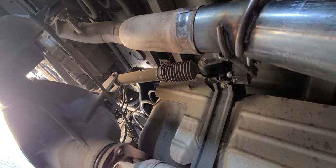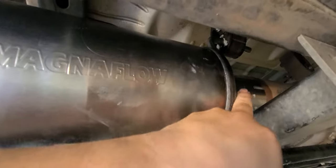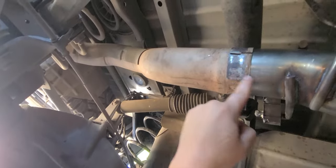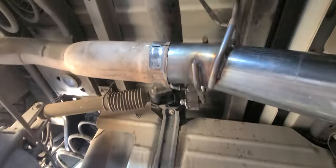Let's finish putting this together. This is fun because one of these goes in this way and one goes in that way, so I had to put these in first and then pull like crazy. I had to slide this all the way down to be able to get the front piece to slide in right here. Get your lube out and go to town on those rubber bushings because they'll fight you otherwise. We got her back in — just got to put the clamps on. Have a buddy help you wiggle this from the back up and down while you're pulling the two pieces together. Works great. Thank you to Brian from Project Nitrous for helping with this. Let's put some nice band clamps on here and get this thing sealed up.